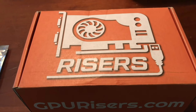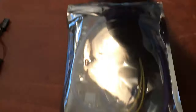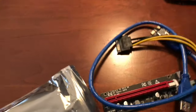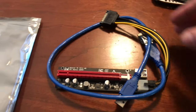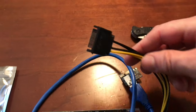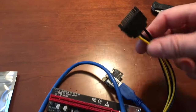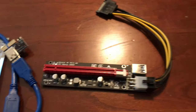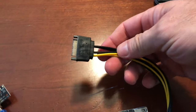I started out getting GPU risers and then they ran out of stock. I needed some risers so I went over to this other brand on Amazon and immediately noticed the difference. This is what you get from the Amazon vendor — they give you this little SATA power coupler. You do not want to use those at all. Don't use it because the power draw — you're going to be pulling a lot of power on these PCIe cards for your GPU and these little connectors just might get a little too hot. So don't do it.